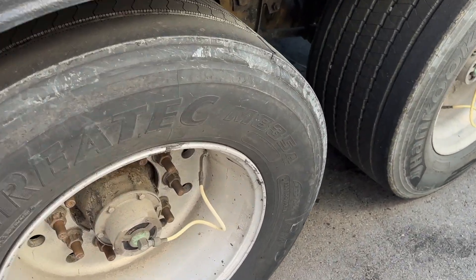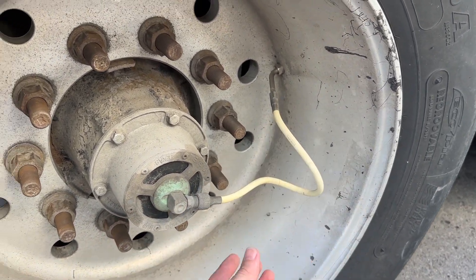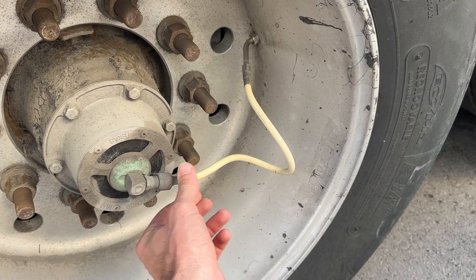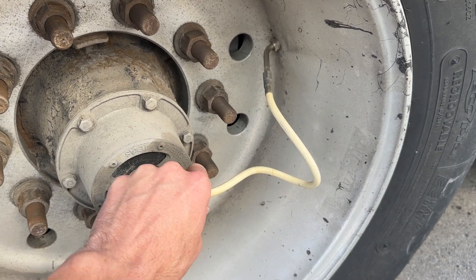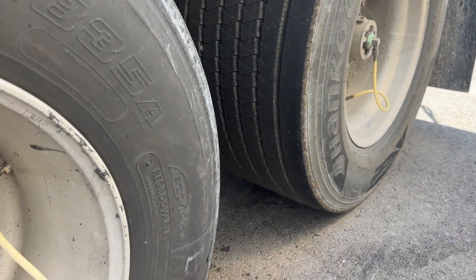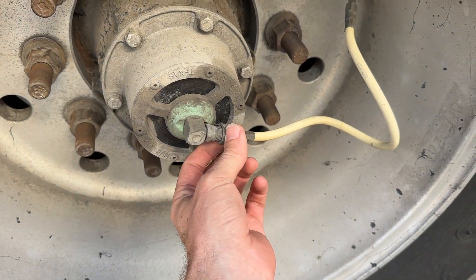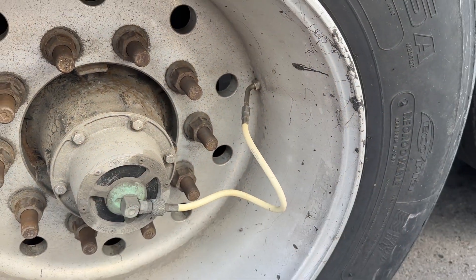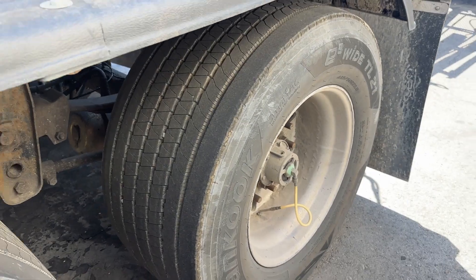Let's talk about these air lines. This is how the system gets air — it comes through the hub and into your tire. These lines can go bad, just FYI. If you have to get a tire done over the road, when you tighten this back up, just finger tight. These have O-rings in them; you don't need to crank on them really hard. If you ever want to double-check your system, you can take this off the hub, spin it off, and there's a little stem where you can stick your tire gauge right on it and take the air pressure of your tire. That'll give you an idea of how much air is in the system overall.